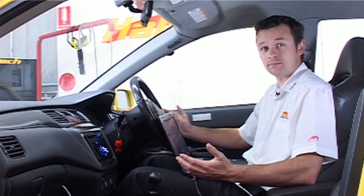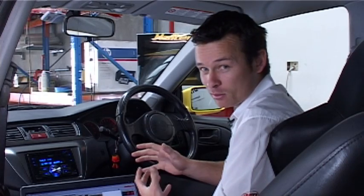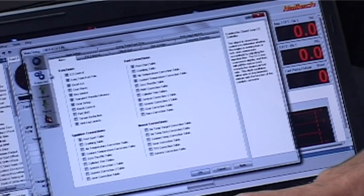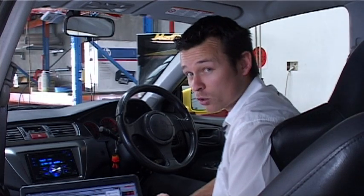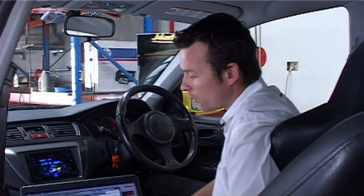There you have it. So now let's get to tuning. Now that we're online with the ECU and the engine's already tuned, it's important to note that you don't want to use the long-term and short-term fuel trims as a replacement for correct engine tuning. But once the engine's tuned, we want to go online and press F4 to get into the main setup. From the main setup we want to go to the advanced tab, and in here you'll notice that we have both the O2 control and the long-term fuel trim turned on.